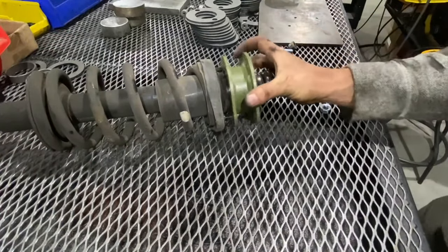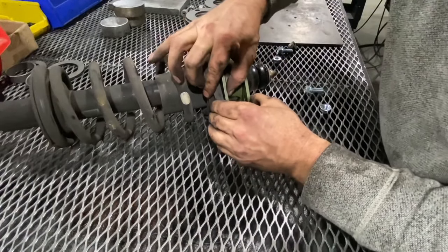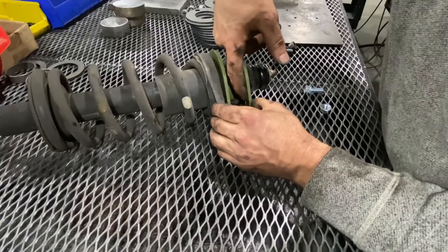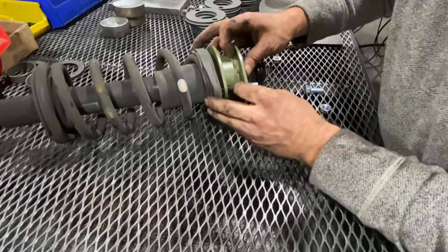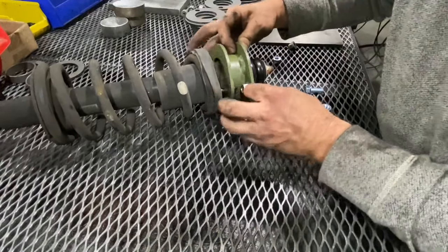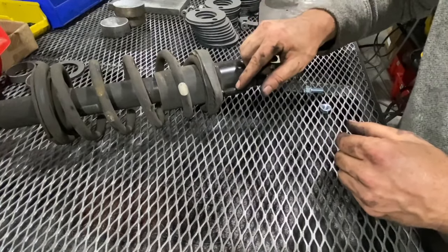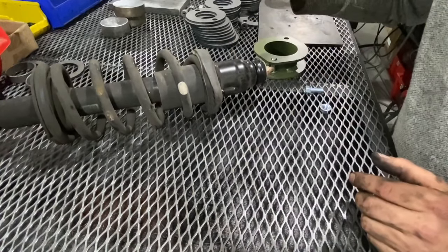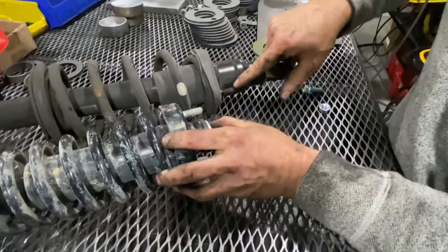I'll show you the proper way to install these spacers onto the strut. One thing you have to notice right away is that when these things are fully bolted down there's only a tiny little bit of space between the tip of this stud and the bottom plate here — and there's going to be a bolt there. So when you tighten them all the way those two are going to touch. All you have to do is cut a tiny little bit off the end. The factory struts have these little tapers on them and cutting that off isn't going to hurt anything.